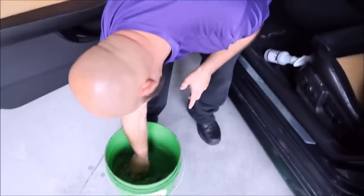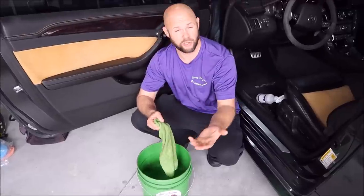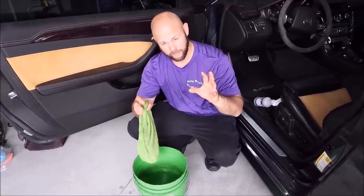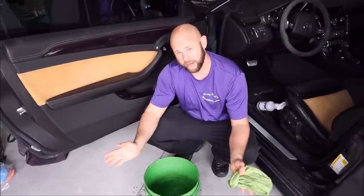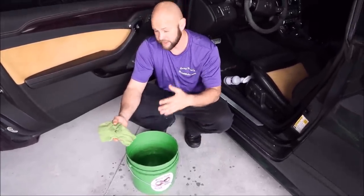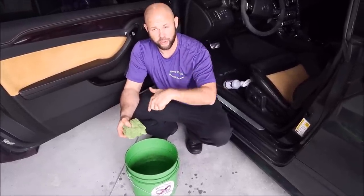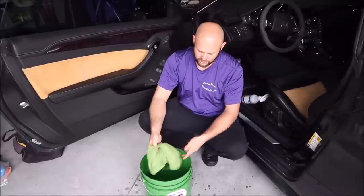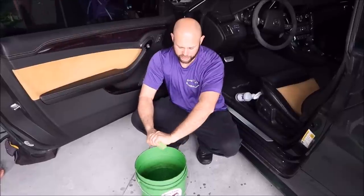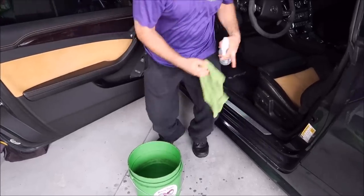Here's how I generally deal with interiors. I'm a huge fan of the damp shampoo method. I didn't invent that — I just started talking about how I use it, and now everybody associates it with the Gary Dean interior method. Take a microfiber towel. I always start with a gallon of water — that's my favorite increment. You start with a gallon, mix your dilutions and products by the gallon, then pour your diluted solution into your 16 or 32 ounce bottle. I soaked the towel in there, wrung it out, and this is what I use to damp shampoo the seats and interior.